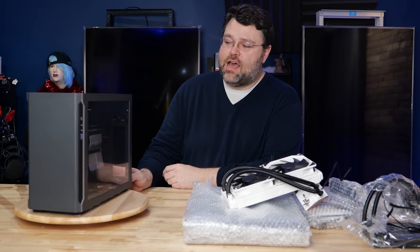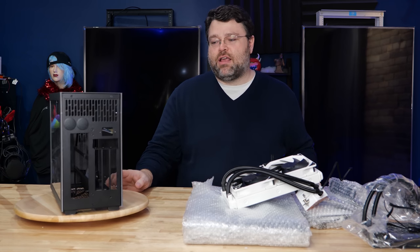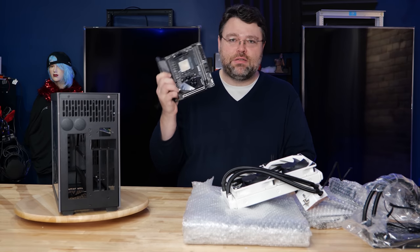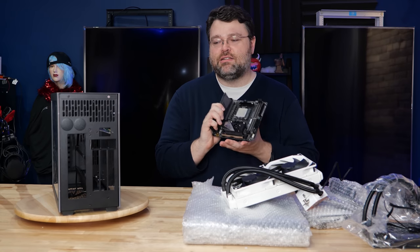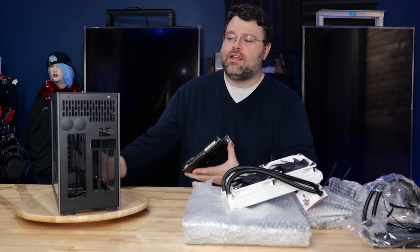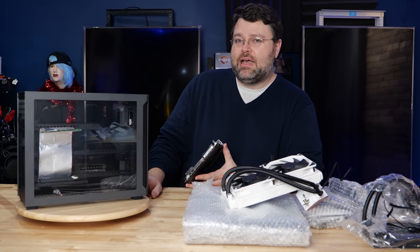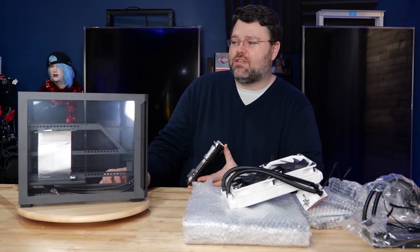The first thing that caught my attention was an ITX case that legit supports two PCI Express expansion slots. Some motherboards support bifurcation on their PCI Express. I've got a Gigabyte Aorus X570. This has got dual NVMe support and we've got our X16 slot here. You can plug the X16 slot in and this case will give you through its cable two X8 slots. I've already tested this cable — that's why we've got fingerprints on the case.